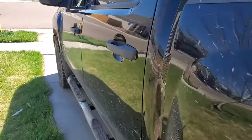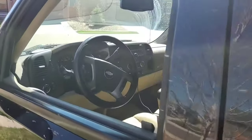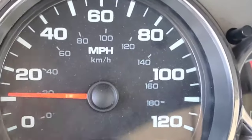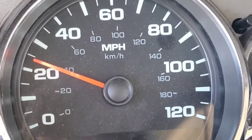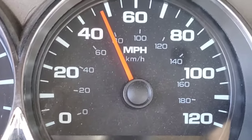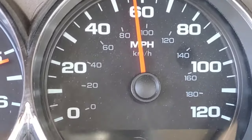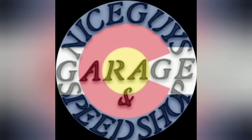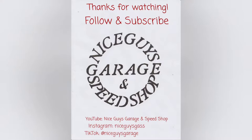Let's go give this thing a quick road test. Make sure it holds oil pressure. I like to run her fairly hard, up to about 60, get her up into the RPM range. Watch your oil pressure — this way you pressurize the system and can check for leaks. Gauges look good. My idea of going through the top of the engine mount worked out — didn't have to remove the front axle. I hope this video helped you out. Comment below and let us know. We'll make more of these if you like them. Thanks for watching.